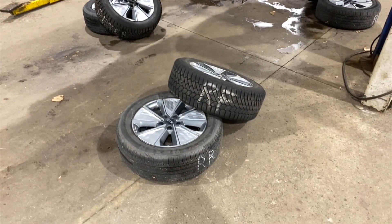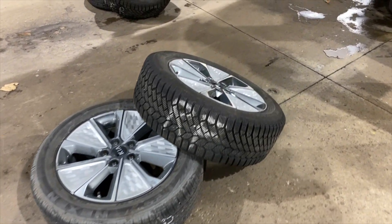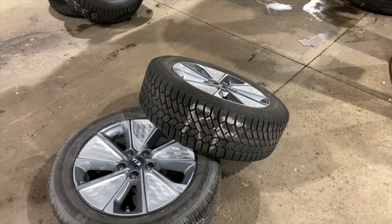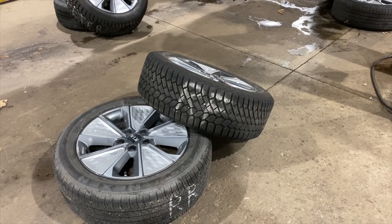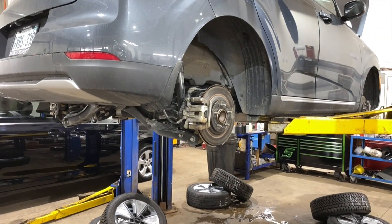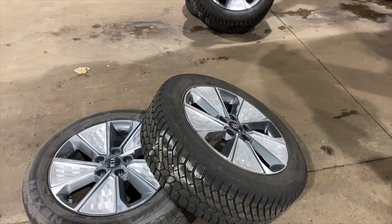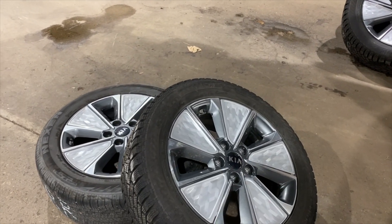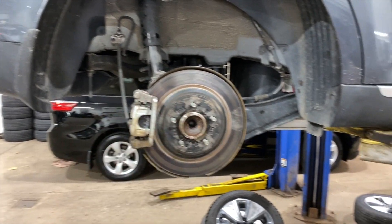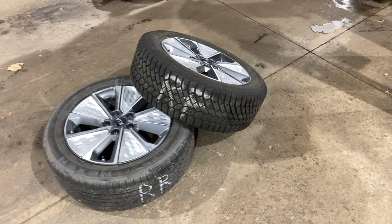Now we're doing the winter tire swap. We have the right rear tire that came off — I have the same-size rims for winter tires. You want to make sure you label your tires when they come off. The technician needs to know in spring where that tire came from, not just where it's going. On tire sizing: you cannot downsize on an EV. The brakes are fairly large — we could fit a smaller size on the rear but not the front, so you need to go with the same size tire for winter.